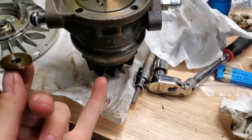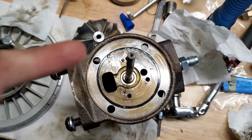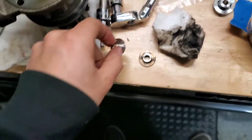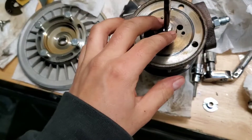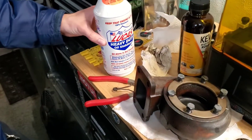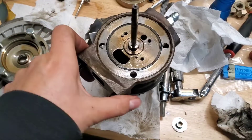Pop the ring in there with your heat shield on the back, and everything else is all set. This bearing doesn't have a snap ring on the front — it does on the back side to keep it from moving. The old one worked fine, so I'm going with the flat OEM-style one rather than the new one with the weird conical face. You should use assembly lube for all this stuff — I'm using Lucas Heavy Duty Oil Stabilizer. It's like molasses — anything thicker than oil that'll stay on there and survive a few seconds of heat is good. You can see there's barely any drag and the bearings are working.